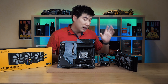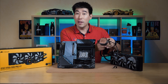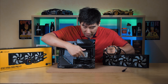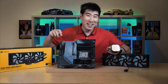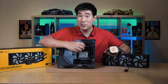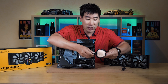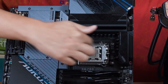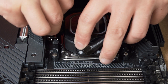With AM4 coolers, you do need to make sure — and this is one of the coolers that was recommended and has been working very well in my testing — that the AM5 will have these brackets here which you can see. You don't want to take those off because you do need those brackets. That's one thing I found with the very first cooler that did not work. You cannot take those brackets off, and you also can't take the inner bracket off because that is the socket itself. What you need to find is an AM4 cooler that has these little mounting holes that latch onto the sides of these brackets. I'll have a close-up shot so you can see that these things here can latch onto it and then you can tighten it on.